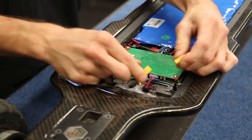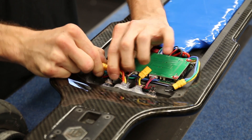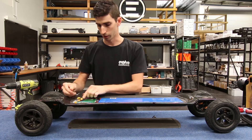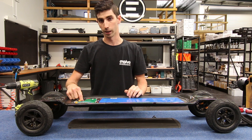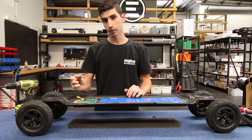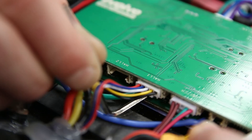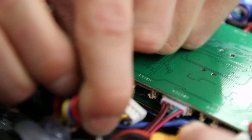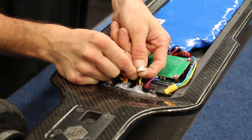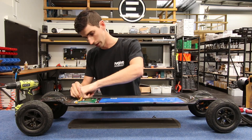From here what we need to do is swap over these power connectors and these hall sensor connectors. These yellow ones simply pull apart as such. The hall sensor connectors down here have very thin wires, so we need to be very careful when pulling these out. A trick is you can use your allen key from your Toolkit to lift up the clip underneath the connector and they come out like that. Do that for both of them.